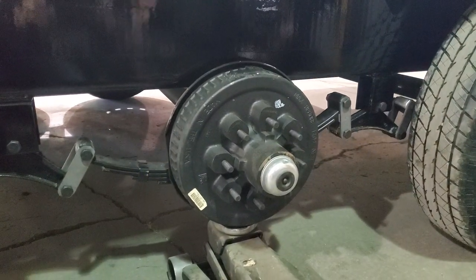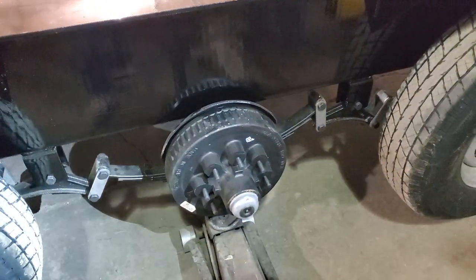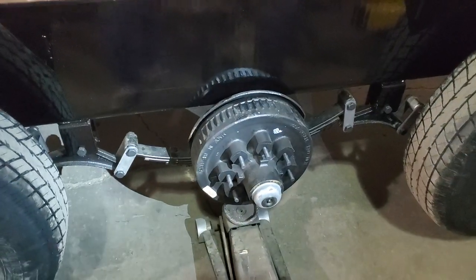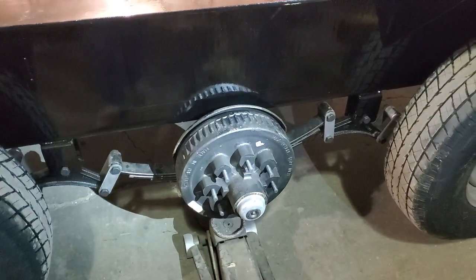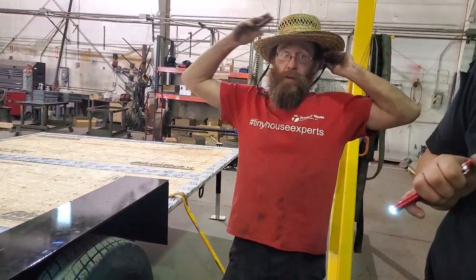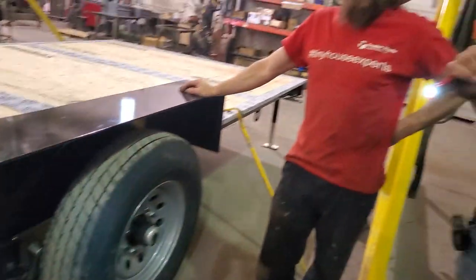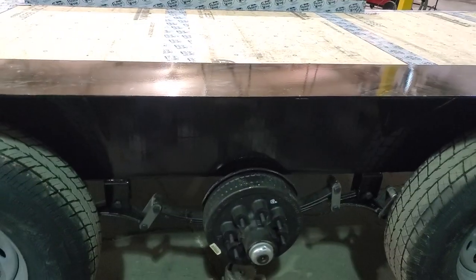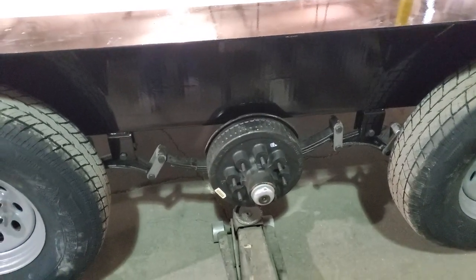You can see we're picking that up to get it centered more in the middle of its stroke. Now go back to your jacks at either end of the tiny house foundation and put your tire back on. After 15 minutes of working at it, we finally got it. Sometimes one floor jack and one pry bar is all you need. It depends on whether one side or both sides fall out — if it's just one side, you can usually do it with one jack and it'll pop itself back up, but when both sides fall out it's a fight. If you have questions or comments, feel free to reach out to us. Thanks for watching this how-to video from the tiny house experts.